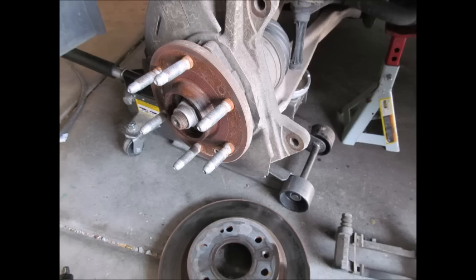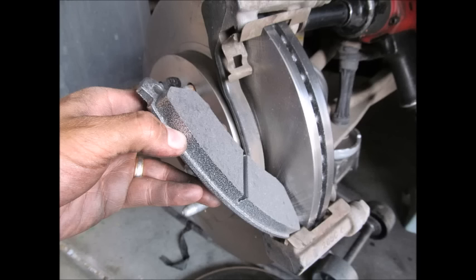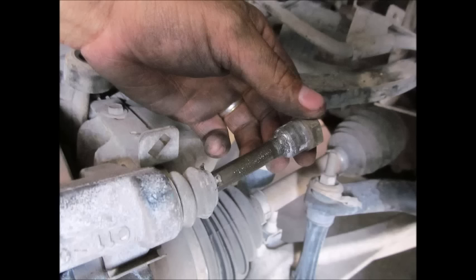There's a possibility you can take the rotor to a shop and get it machined — it's between $15 and $30 to get them turned. But oftentimes they'll tell you that you can't turn them. There's actually a stamping on the inside of the rotor that tells you how much needs to be left and the minimum tolerance. I almost always just replace them. Here are the bolts — I use red Loctite. Make sure you follow the specifications, then put everything back together just like you took it apart, including the brake pads and guide pins.